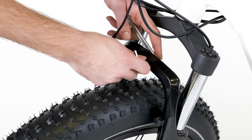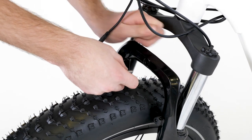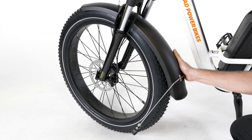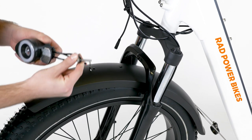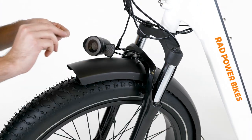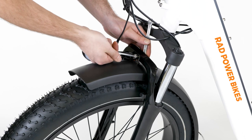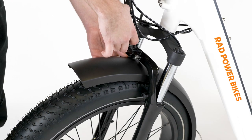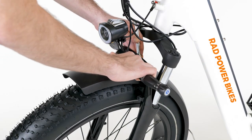To install the headlight and front fender, first remove the headlight mounting hardware from the fork arch using a 5 millimeter Allen wrench and a 10 millimeter wrench. Pass the fender from the back of the wheel forwards under the fork arch. Pass a washer onto the bolt, then pass the bolt through the headlight mount, fender mounting point, and the fork arch mounting point. Then install the remaining washer and thread the lock nut onto the bolt end. Use a 5 millimeter Allen wrench and a 10 millimeter wrench to tighten the bolt part way. Center the headlight and ensure that the angle is slightly downward to illuminate the ground in front of the bike and not to blind oncoming traffic. Torque the headlight mounting bolt to 6 newton meters.